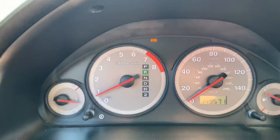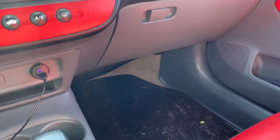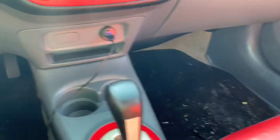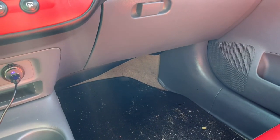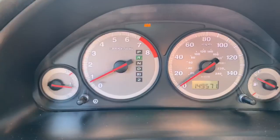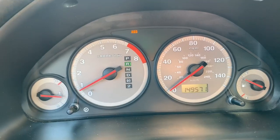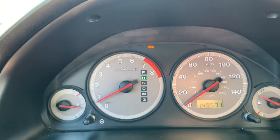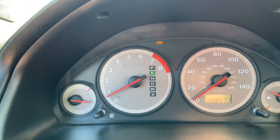Put the car in reverse. As you can see, it's in reverse. I did, however, have to change out the range position sensor on the side of the transmission, which is down there underneath behind the passenger tire in the engine bay. I did have to change that out with the original BMXA range position sensor because it was not working. I was told to do that, but I was going to see if it worked and it did not work for me in this specific application.